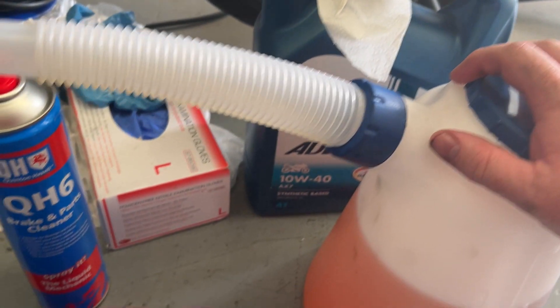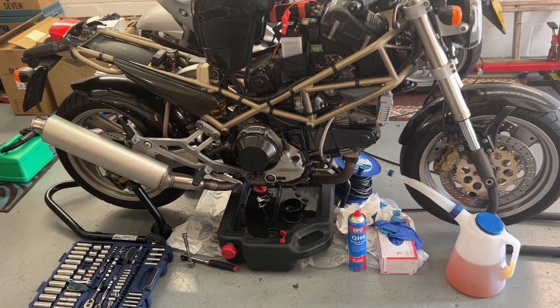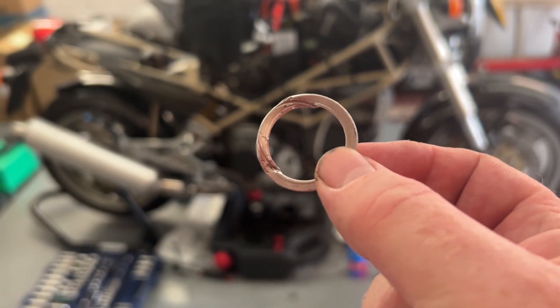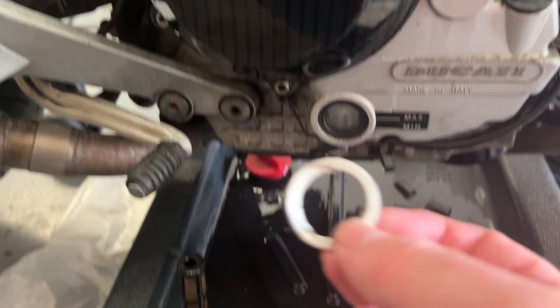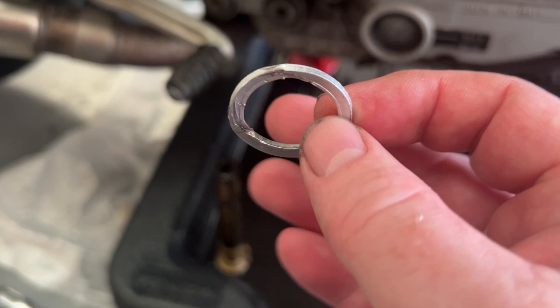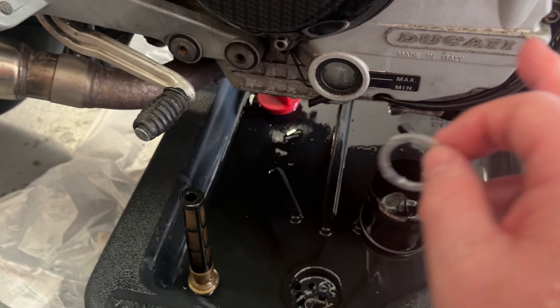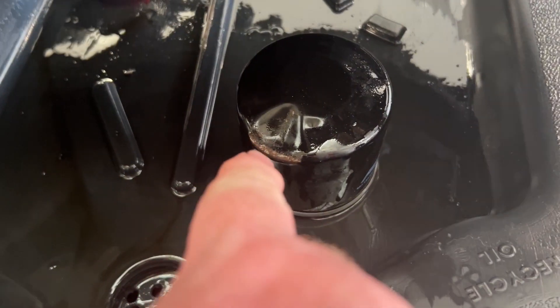Time to pop some oil in — I've decanted the Shell Advance. I'm going to be the first to admit that no one is perfect and that includes me. You would have seen me tightening up the sump plug and I didn't make sure it was near the flange — it was not perfect and I ended up crushing the aluminium washer. I saw the first drip and stopped, pulled the strainer off, and confirmed the damage. Story of my life — I'm now ordering a genuine Ducati washer. I make mistakes, I'm not perfect. Sorry Andy, but at least I didn't do that. Thanks for watching.